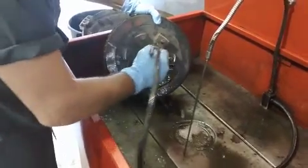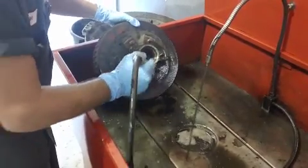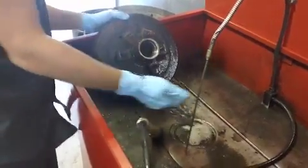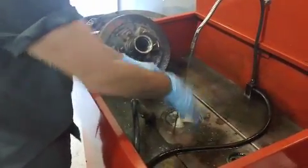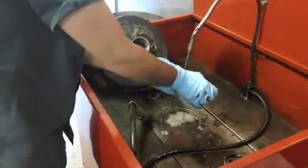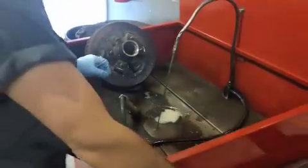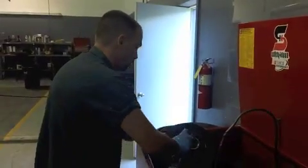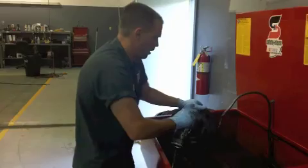What would typically cause that if you let your bearings go too long? Yeah, any water got in them and you're running, the hotter they get, the grease actually thins out and turns into almost like graphite. And then it just starts drying out, and then less grease. The bearings will actually heat up. They'll start discoloring, and then it gets a lot worse from there, and then you'll start seeing the bearings and everything lock up. And that's when you have a big problem.